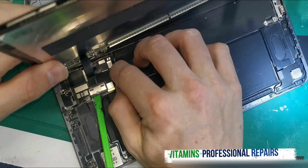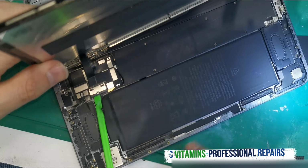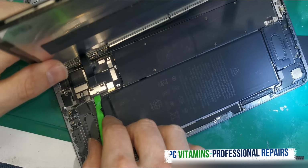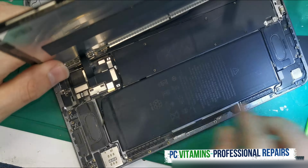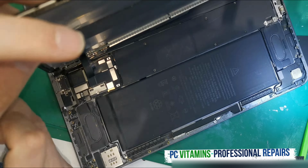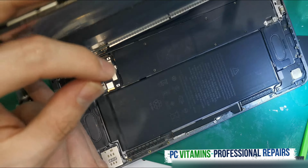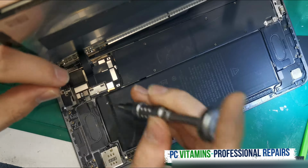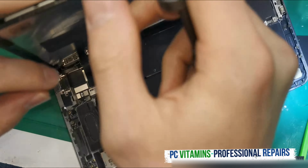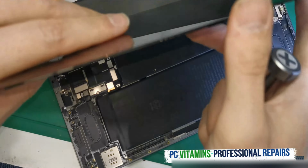This is on the 3G models. This is the Wi-Fi antenna to help assist with the signal. Disconnect. Make connection. Just take a screw. Power, let us put the battery plate, connect the Face ID, and then we can test.